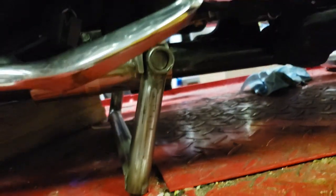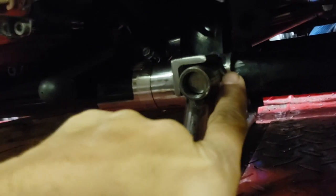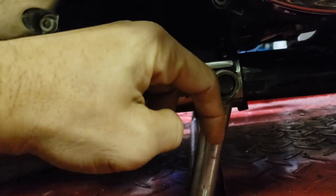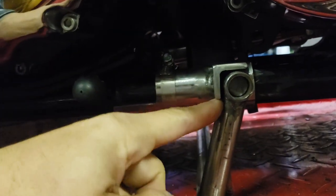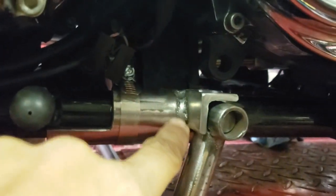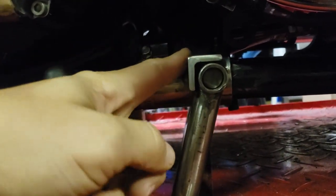She's been sitting on the center stand out here on the lift. I've moved it around a lot and it hasn't shown any signs of failure. I'm looking to see if it's going to fail at this weld, because there's just a piece of half-inch solid round stock coming off that this is attached to. This brace here is to be a stop when it goes up and a stop when it comes down — right now it's actually resting against this face. And this has not shown any signs of failure at the weld, which is good considering this is one of the first structural things I've made since I started practicing welding.